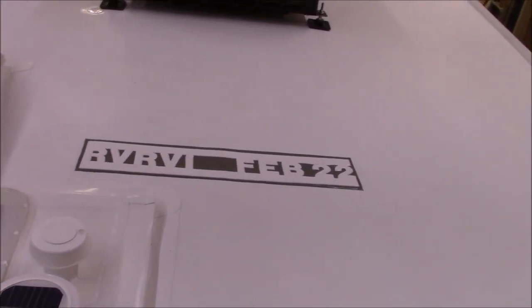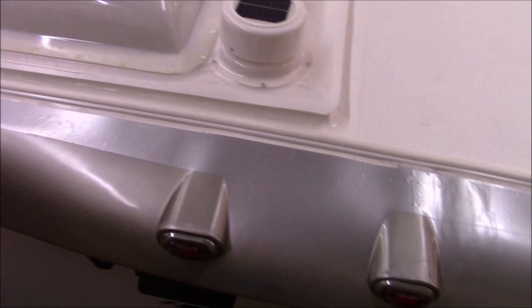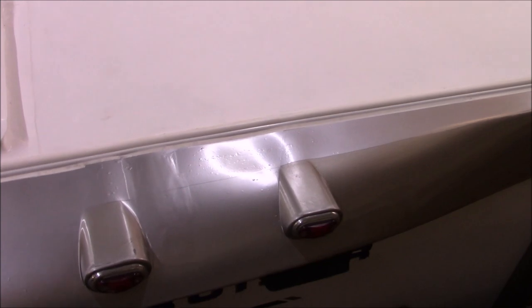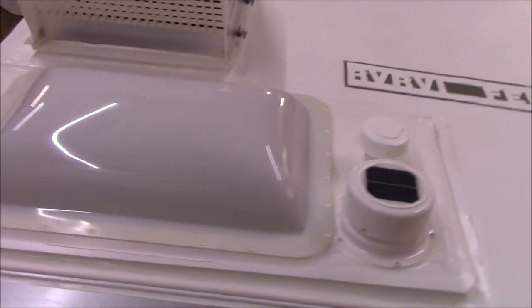We are done. We put our logo on there — it has February 2022 stamped on it so we can keep track of the roof when it comes back for inspections, or if the customer goes to sell the coach so nobody can talk the price down by saying the roof is bad. You saw this was a spray roof. One of the things we already did is put a decal on here because that was cracked — we epoxied it and found the best color match we could to conceal it and keep it watertight. I want to thank the customer for bringing the coach in — we really appreciate the work.